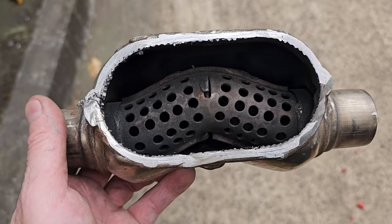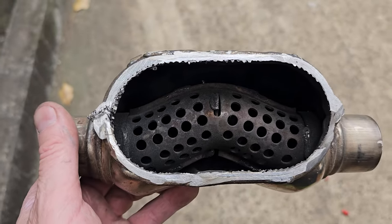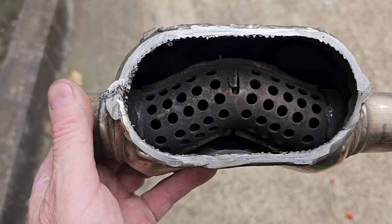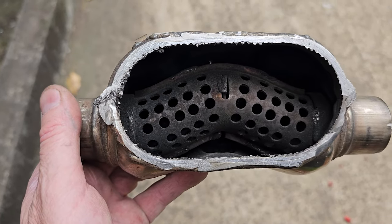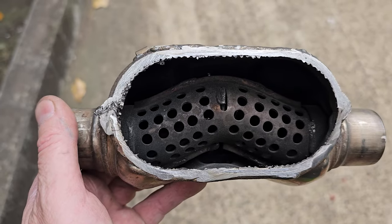And even with leaving this in there, I'd like to leave this in there as well, because both them pipes point at each other from different cylinders, so the back pressure from the other cylinder might actually restrict the flow a little bit, so I think that thing might even help.